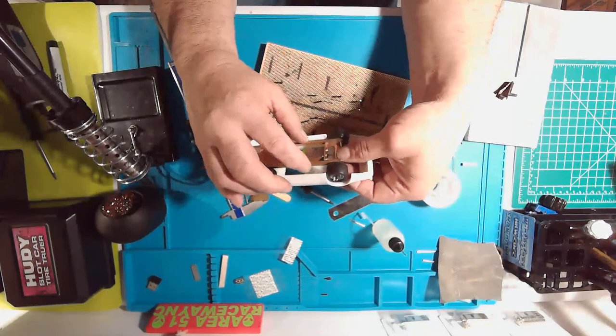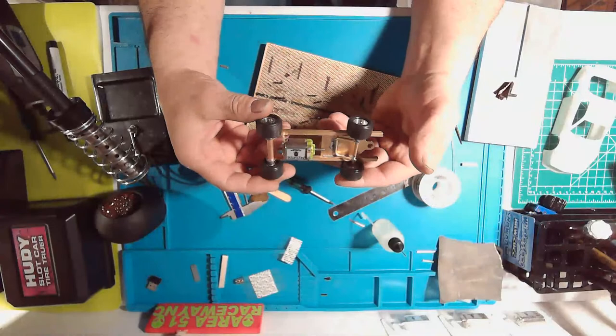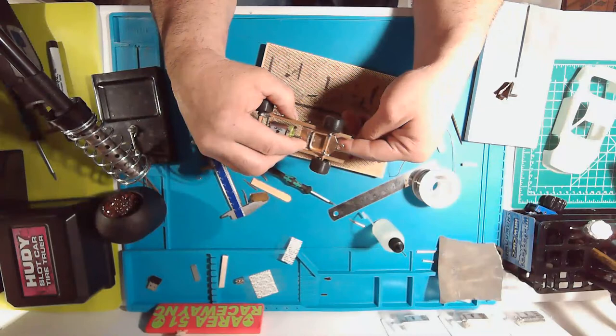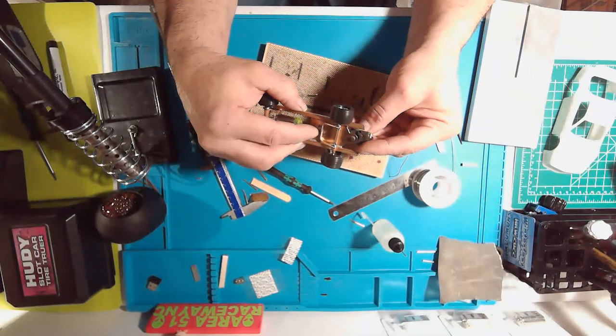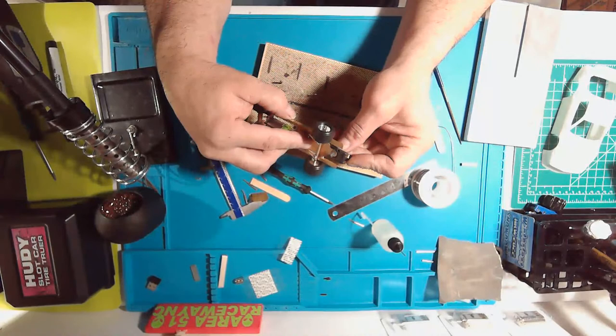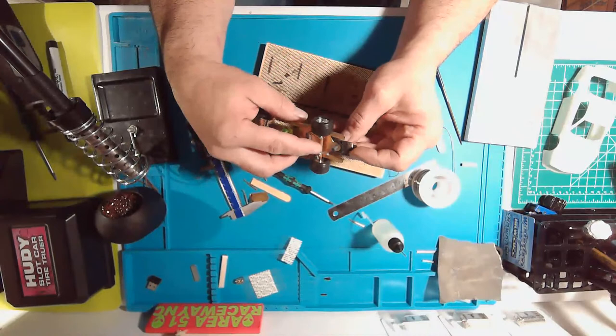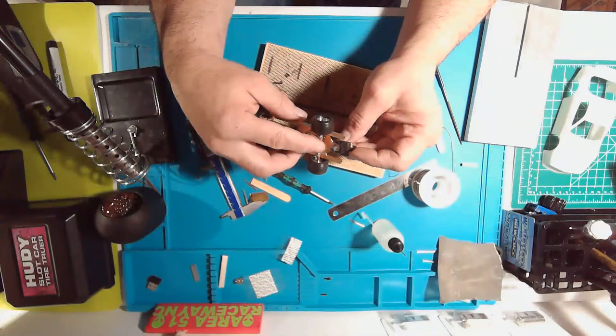I hope you learned something from it. It's not hard to do. I think the most important part is setting your front axle height to make sure your guide tongue's in the position where it needs to be, because you don't want the axle too high and then put the tongue on. You could shim it, but it won't bring the wheels down, because the axle's too high. I'm probably not explaining it right. So you just want the guide tongue in the proper position, and the axle height in the proper position, so you're able to drop this and have the wheels contact on the front.